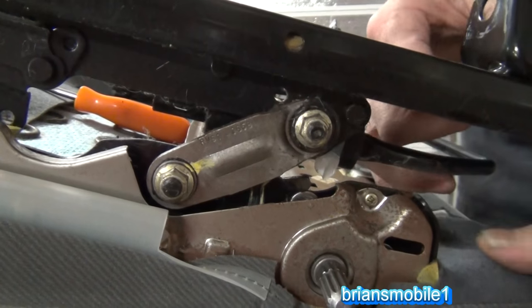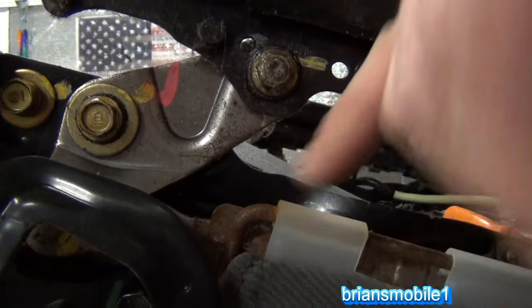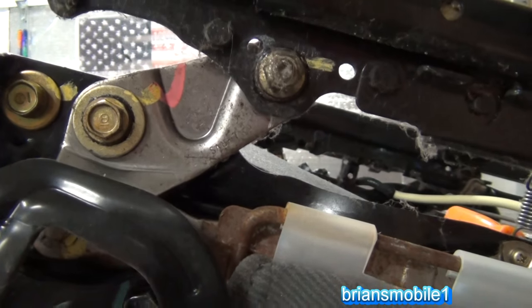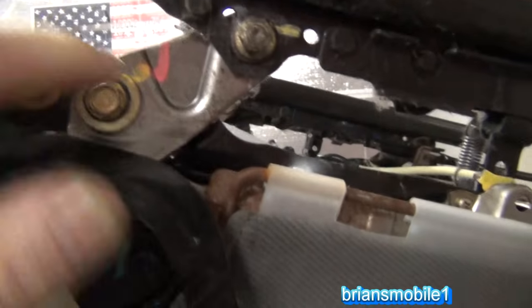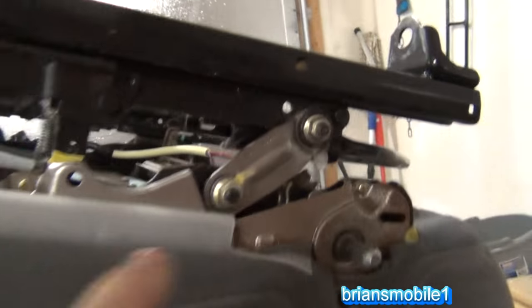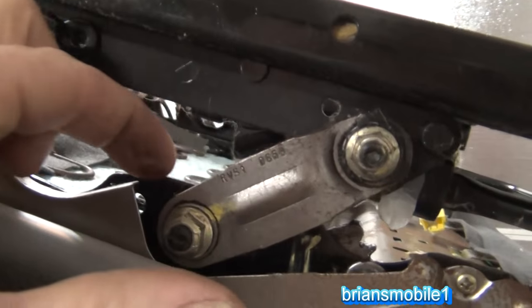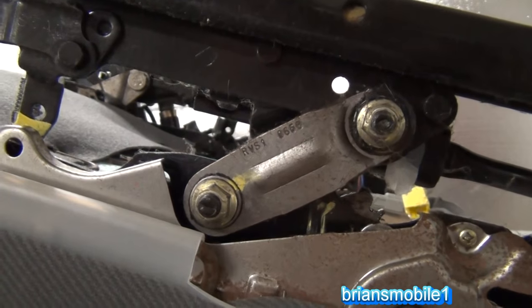This is the opposite side, but we have the same thing. These aren't wearing out so much — well, yeah, they are — it causes the whole thing to move together, it's just worn out. So to recap, I need to weld right here, across here, here, and this little joint there. I need to tighten these excessively — that might even just take care of the whole thing and not have to weld it all.